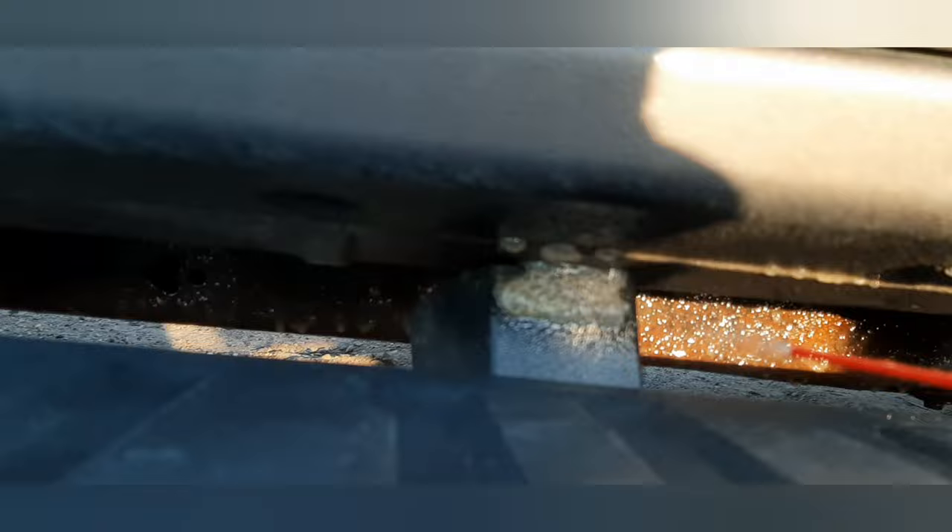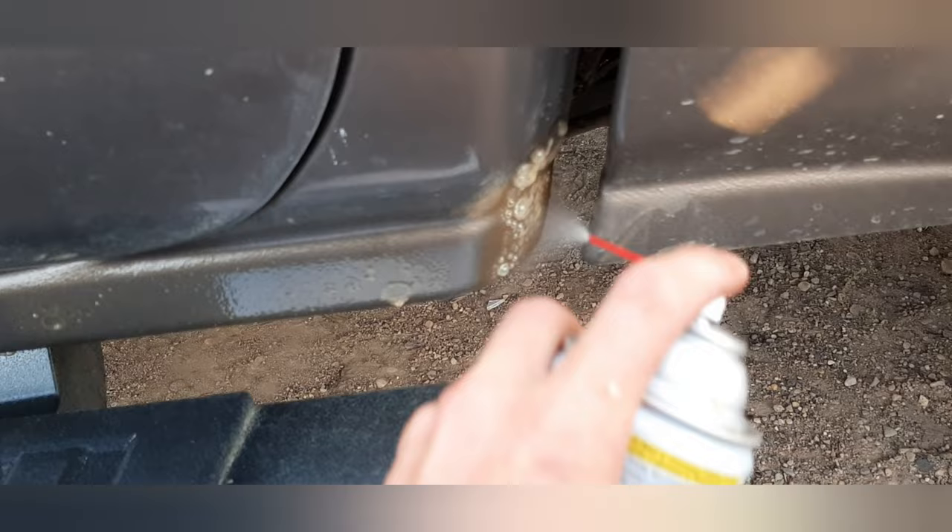Also make sure to get back there. I am gonna spray the inside of every panel on the bed, but I don't have enough to finish that today. On these Chevys — and it's probably the same on a lot of other trucks — get up in here, any little holes you see. The whole back liner of the rocker panel, because that is where your rocker panels rust out from, from the inside out. Any little holes like this one right here — there's a few of those — get all up in there, every little bolt, everything you can possibly get.